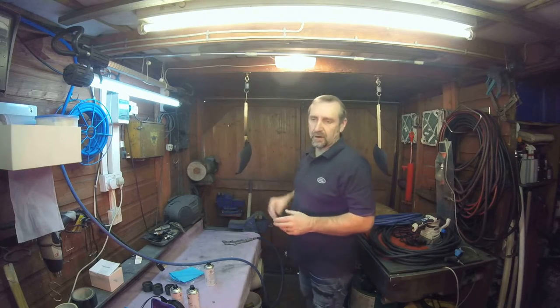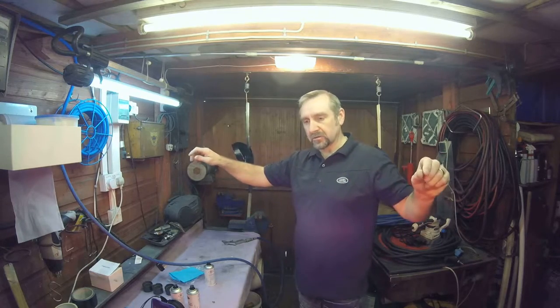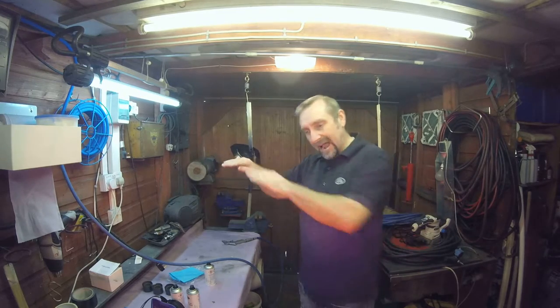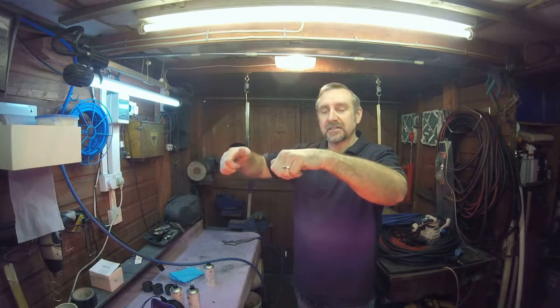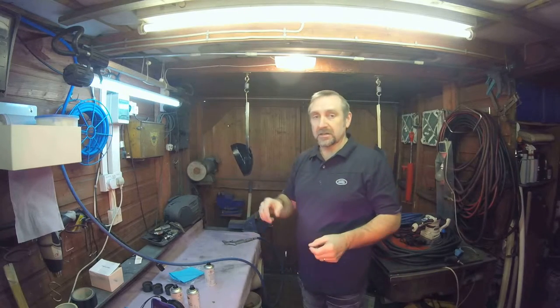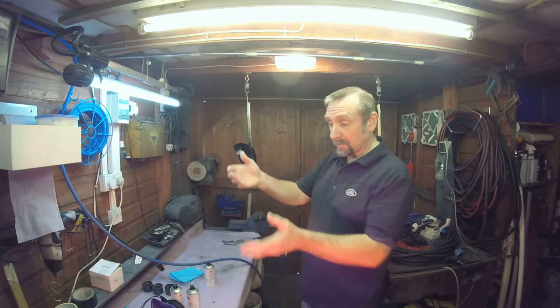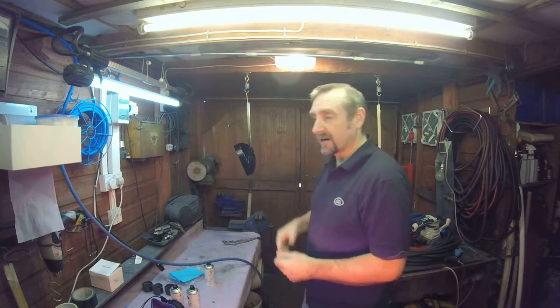This is why I've said before about painting bumpers and things on a car. I've seen people mask off the rear quarter of a panel of the car and then paint up to the bumper line. If you can get that paint to go into the bumper edge and round, there's less chance of it peeling back from like jet washing and things. So for the sake of undoing a few clips that's normally on a bumper cover, dropping it say an inch and being able to get paint inside there, it won't peel.